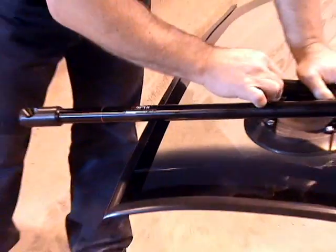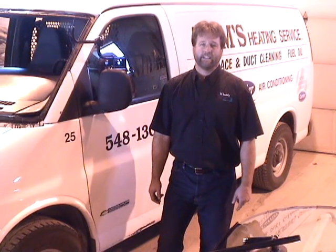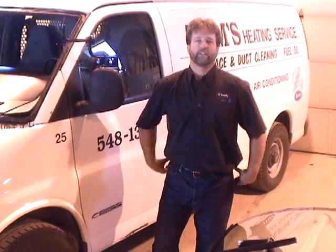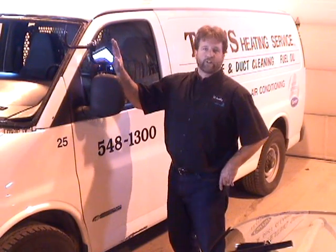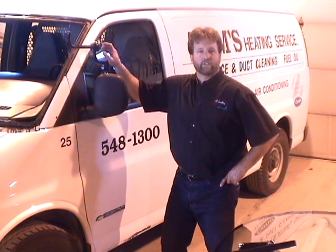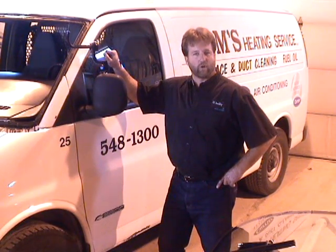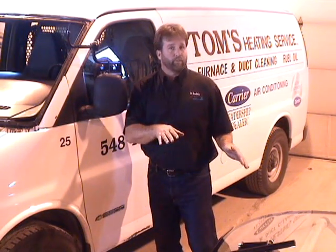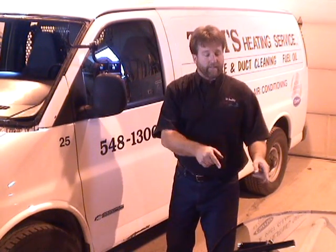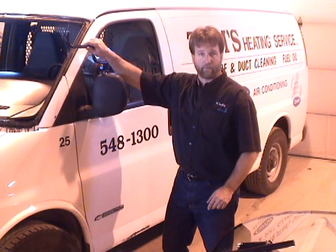With the design of Lil-buddy Pro, the idea behind working with this tool is to alleviate stress on the back. It's to have accurate sets in vehicles, and it's also to eliminate the second man from going out on the road to set the larger windshields. So now we're in position to set the sliding rod cup onto the base cup.